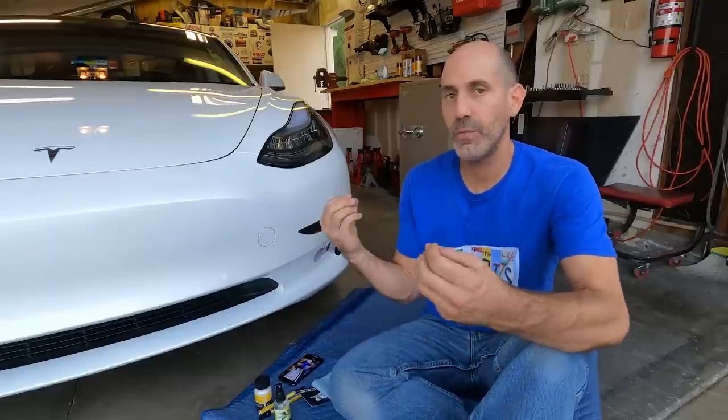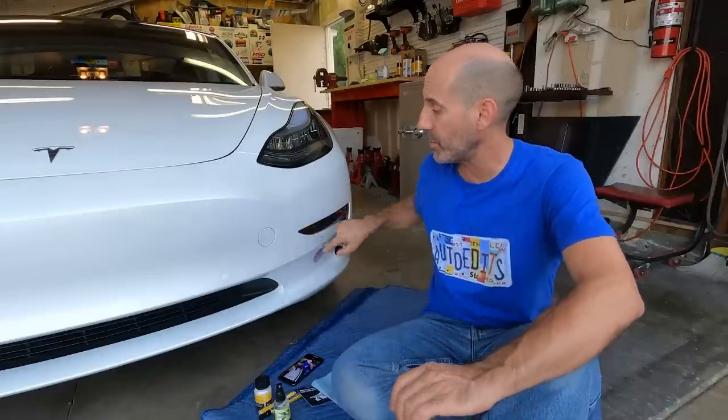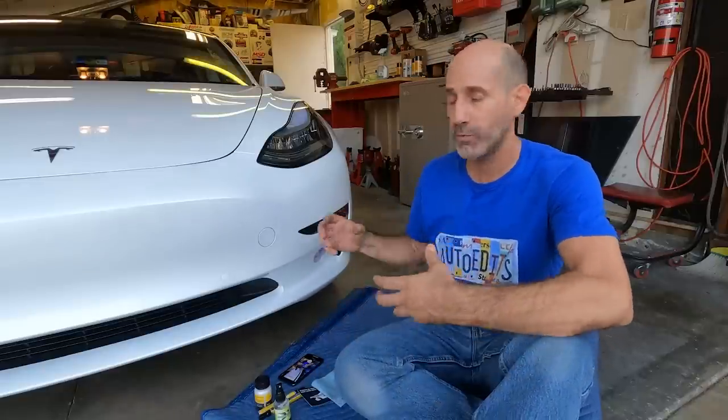I planned wrong today - even though it's really hot out there's a little bit of humidity so this stuff is just not drying. I'm going to let it sit overnight with this second coat of mid coat before we put the clear coat on tomorrow. Take your time - this is just one of those moments where I could rush but I don't want to ruin it. It's looking pretty good and we'll see you in the morning.